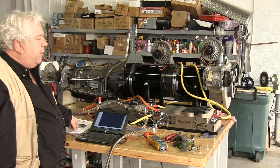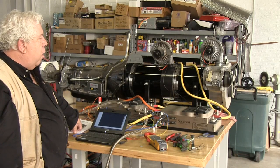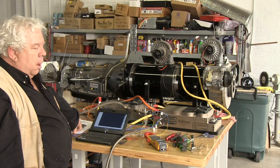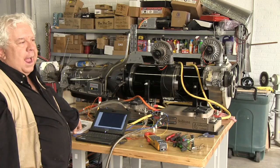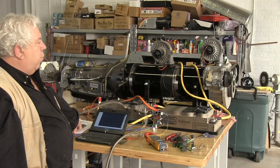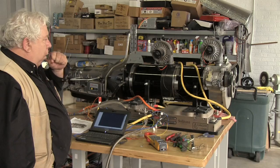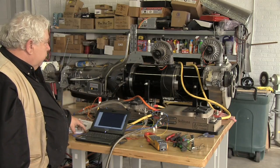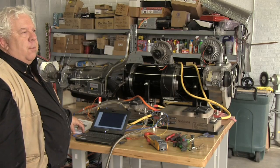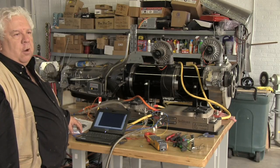From there it's a matter of working off some of the sensor issues and the OBD2 issues with the car. And generally I always see much darker things there than what we actually encounter. In almost every case when we actually got down to it, it worked great right out of the box and had a couple of anomalies. For example, the Mini Cooper power steering won't come on until 600 RPM, and it's a manual transmission. We don't have 600 RPM.